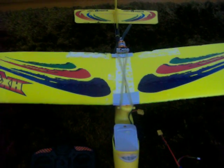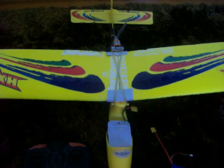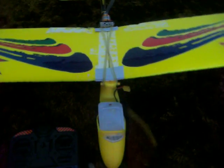It's had a few crashes with the brushed motor, and that's why we've done this update to all the components. LiPo battery — that's a 3-cell — and it's a Turnigy motor. I've mounted it with a bit of alloy on the back of it, just with screws, and it's got a 6x4 propeller. It's a Turnigy motor, B2835, 2200KV. And the ESC is a 30A ESC.